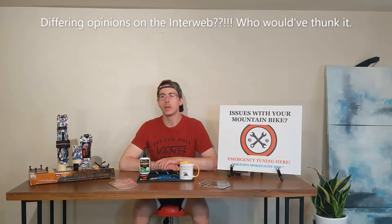What I'm doing is not supposed to be possible. Certainly when it comes to the derailleur, Eagle is never supposed to be substituted in with Shimano 11-speed. I want to hold that to an empirical test and really see whether that's backed by the results. And then with the new shifter, there's been some mixed opinions on the internet. The direct question has been posed: can you use the M9100 shifter with M8000 11-speed? The answer seems to be no. However, there is one good YouTube video by a noted YouTuber who really knows his drivetrains, in which he did manage to use that shifter with an existing M9000 XTR drivetrain. I'll link that video below.